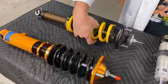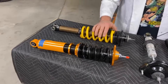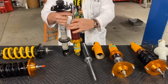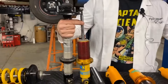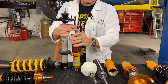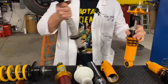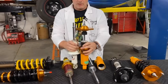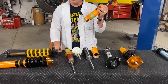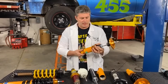I am comparing obviously a very high-end suspension system to a fairly universal suspension system, but you notice the same thing happens. We look at our Bilsteins — they've got about the same length as the Fox does. We look at a Tokico — great shock, too bad it went out of production — it's right about the same as well. So basically this is fundamentally about the length of a factory rear shock, and everyone is using that, except for some of these guys where you just physically can't package it. That is why you don't see any two-piece shocks at Flyin' Miata — we have experimented with them and tested all sorts of different suspension setups, and that's why we went with a single piece.